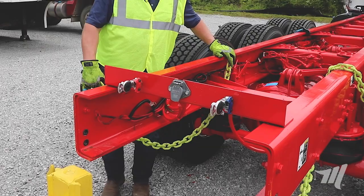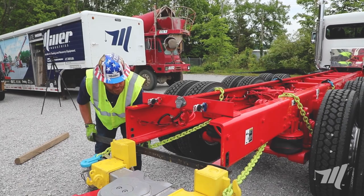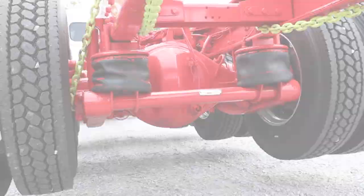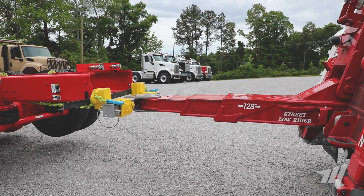When using this method I've always found it easier to use a piece of angle iron — that way the chains won't crawl up the frame rail and it'll ride down the road nice and level. Now that we have this thing hooked up, simply install your safety chains and tow lights and go on down the road.